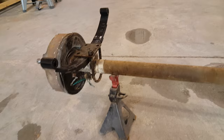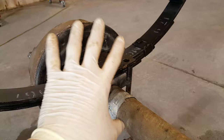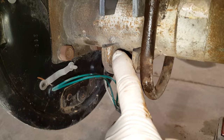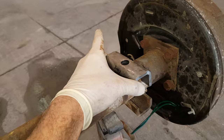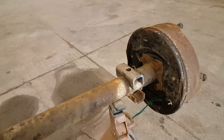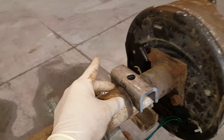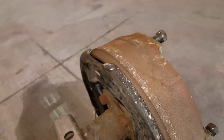I'm back at the shop and I've got it all mocked up so you can kind of see what it looks like. I'm going to have to weld this perch on right here, then the leaf spring goes on top, and then of course the U-bolt would mount it all together. There's the old perch that would have came from the factory sitting on top. I just have to grind the surfaces right here and weld it in place - just this perch and this perch need to be in the exact same spot. I'll measure off the old ones and weld it in place. You don't have to weld this on like your life depends on it - this is just keeping the axle from turning and the leaf springs from turning on the U-bolts. It's basically going to be a bead right around here on both sides.